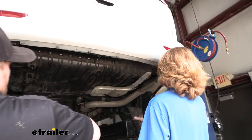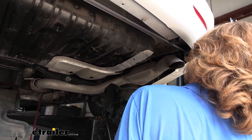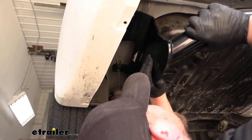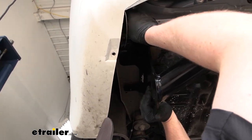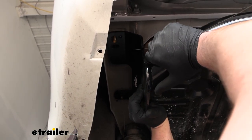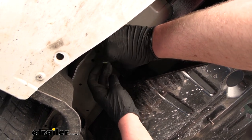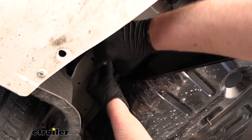With that said, now we can get our hitch up. With a next set of hands, we'll get our hitch going and drop your wires down through the right holes. You want to start on the passenger side, so kind of heft the hitch over the exhaust. Once that is where it needs to be, you can get our hardware to line up and push it up into position. Once we have it up, you want to get the fish wire off, take our hardware combination, and get at least one started on each side hand tight so the hitch will support itself while we work on the rest of the hardware.